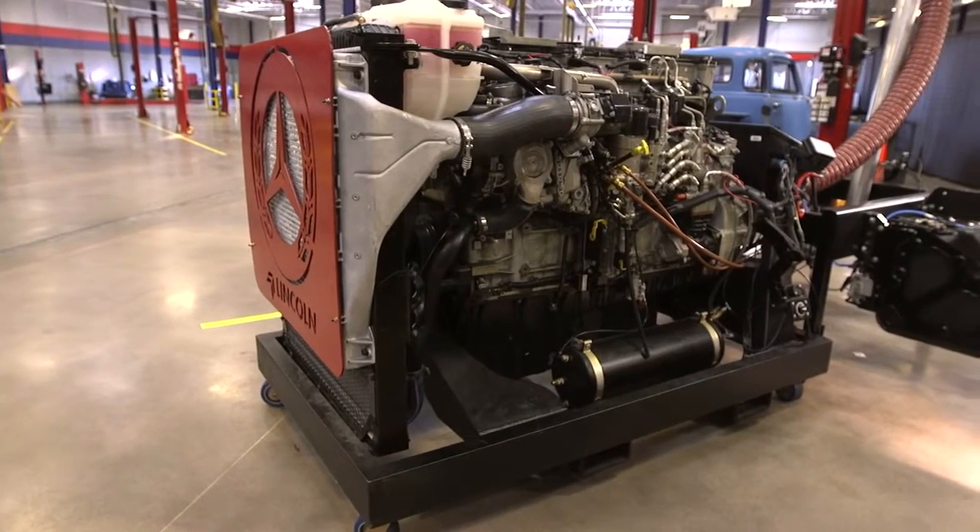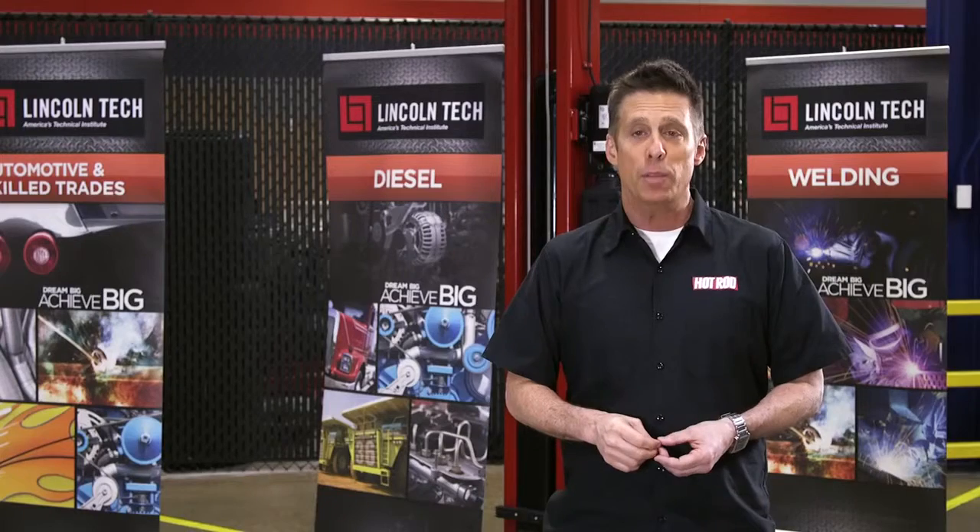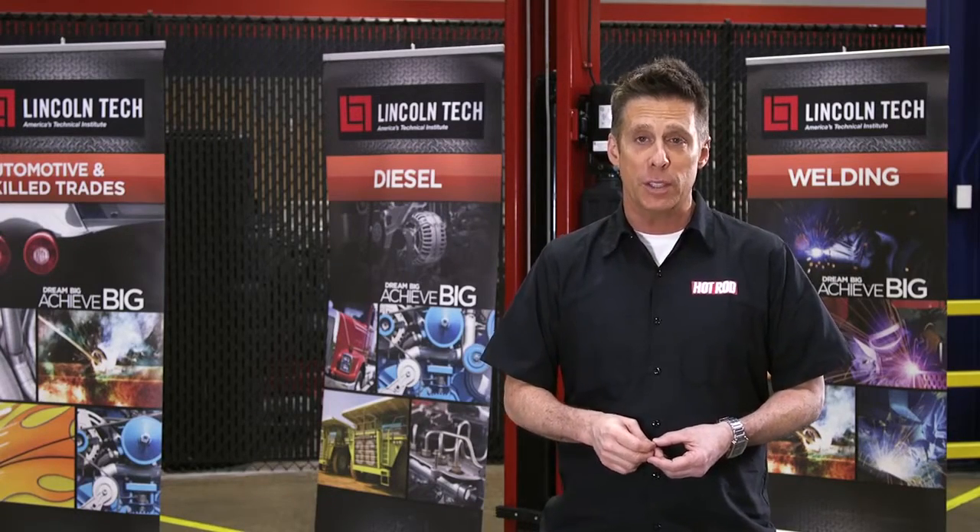You see, most modern diesel fuel systems have a drain petcock located near or on the fuel filter adapter. Just open that baby up and let it flow into a drain pan before removing the filter.